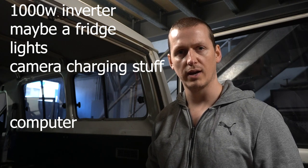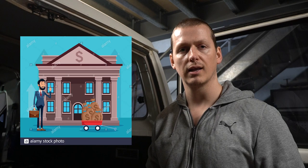So planning here is key. I need to figure out all the stuff I'm going to be running off my secondary battery. Next I have to think about what the current draw is when everything is maxed out. You can think of power like a bank account you withdraw cash from — once you run out of cash, your electricity shuts off. But only if you've done it properly; if you don't, there's a fire and an insurance claim. I plan to run everything through a 100 amp shunt, which gives me 1,200 watts to play with. 1,000 watts of those will be immediately eaten up by the inverter, leaving me with 200 watts of 12 volts to power maybe a fridge and the lights. These values are the maximum possible values — it'll never actually realistically run under these conditions.